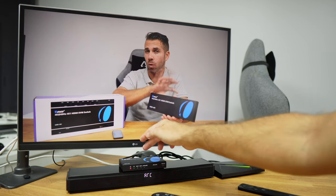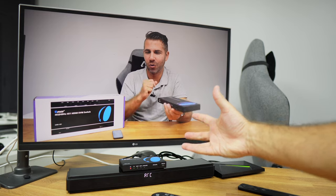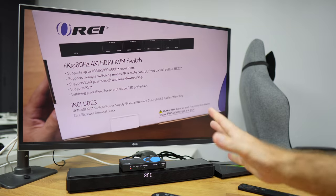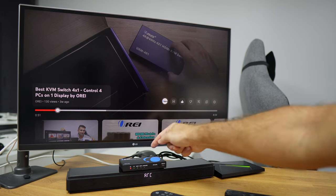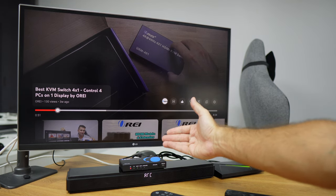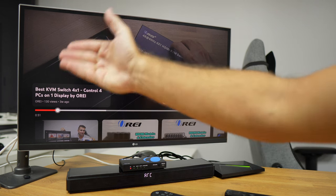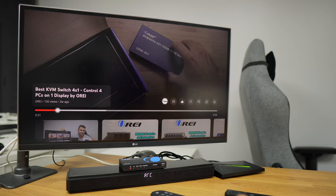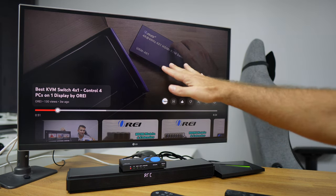The Ori HDA 929 will support everything that is available, including Dolby Atmos and more — you can check the full list of supported formats in the video description below. If I had an audio system that did not have ARC capability, I would simply connect it to HDMI Out 2 instead of the ARC port, and that older system would still deliver great audio.